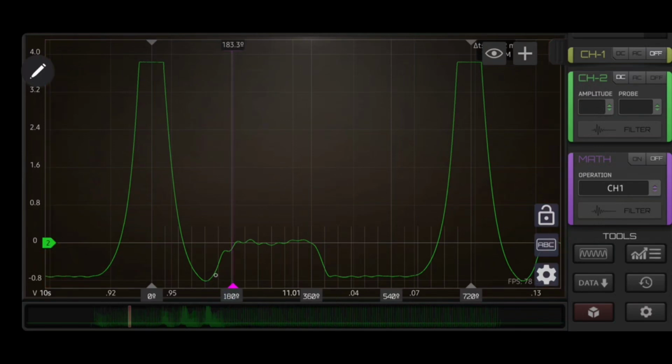As you can see, our opening time here is really pushing the envelope. I mean, that's pretty far before top dead center that it's opening. So we definitely have an issue going on here somewhere. This cam right here is actually very advanced, by like 20-25 degrees.